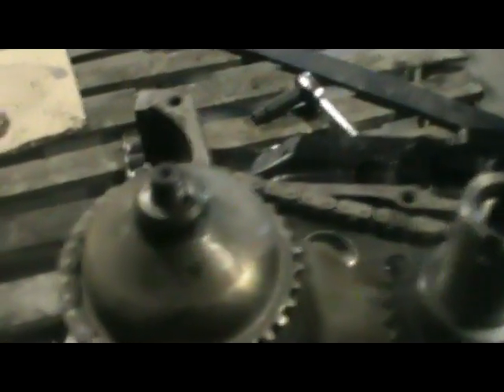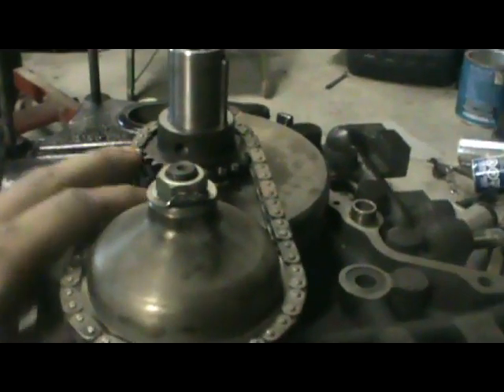Now I'm going to put this little washer and the nut on the oil pump there, and that should be all good to go. I put that on — I torqued it to 30 foot pounds, which is about 28 to 33 foot pounds. Freaking torque that one down. Next is this spacer with chamfered side down. Now I just gotta go around and put the front cover on.